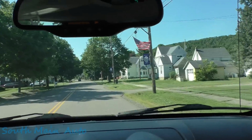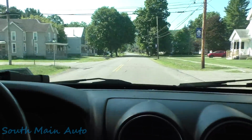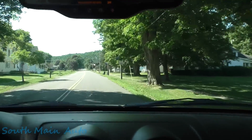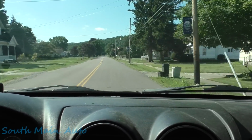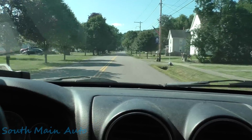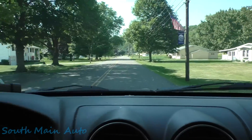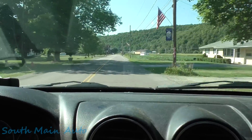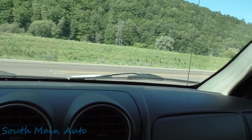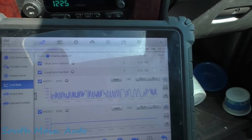And what do we expect to see when we go full throttle? Oh, that's right. This thing's got bad wheel bearings, doesn't it? Hey, there's Vinny. Hey, Vinny. What do we expect to see? We expect to see either to stay in fuel control, oxygen sensors remain switching, some GMs do that, or we expect to see power enrichment mode where the O2 sensors go full rich because the PCM's just putting it right to it. Okay, here we go, folks. Pedal to the plastic.